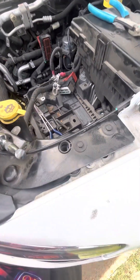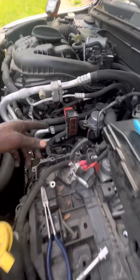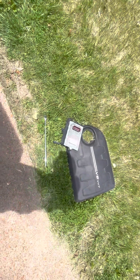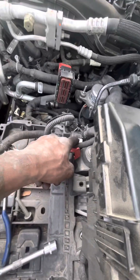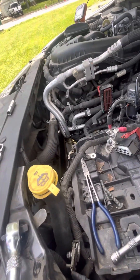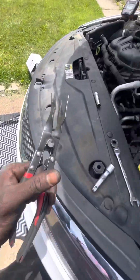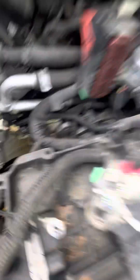I have to take the battery out — two 10 millimeter bolts — and pull it out. And I took the computer module off. You'll lift these tabs up and they'll eject themselves off the computer. Then there's a 10 millimeter bolt right there and a 10 millimeter bolt right there, and it's sitting in these little clamps on the sides — you'll pry it out. After you pry it out, you'll have this wire attached on the side; get it off with one of these. Then there are three wires on the other side — boom, boom, boom — and you'll get them off and be able to get that out.